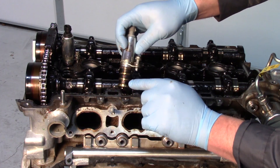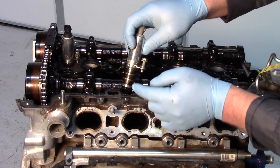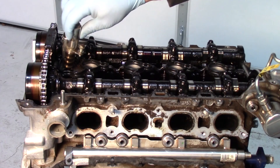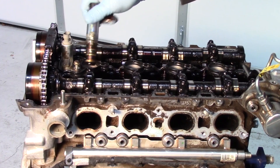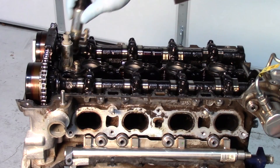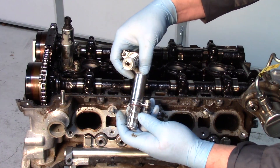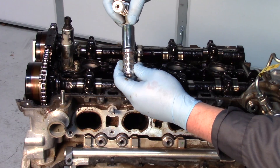The engine oil enters in, the solenoid cycles, and allows oil to go towards the advance or retard cavity of the passageway on the actuator. We can see the exhaust solenoid as well — it's got a fair amount of sludge buildup too. Now with the replacement solenoids here, you can see how much cleaner and shinier they are, and notice the tight tolerance fits and precision machining.